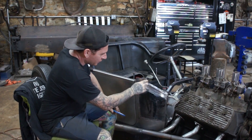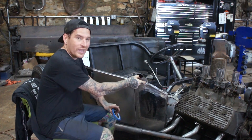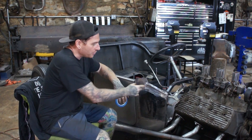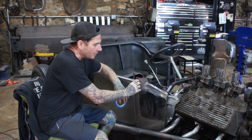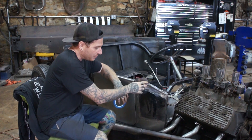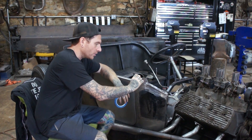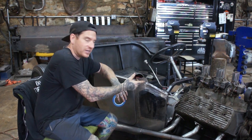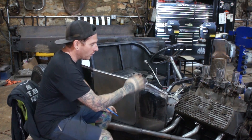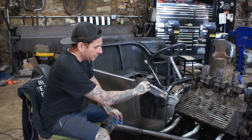So I've got this piece welded in here. Something you guys may have noticed when I was welding the patch in is it's way too tall here — it's hanging up above the door, and it's obviously too much. The reason I did that is when you're welding in a small patch, the heat starts to spread and you will start to blow out the edges of your panel, or it'll start to melt the top of your panel away. So by leaving it long, it'll allow you to use this extra material as basically a heat sink, so when you're welding it'll make your life a lot easier. Now that I have it all welded in, I'm happy with it. I left the seam right here open because we're going to be cutting right there.